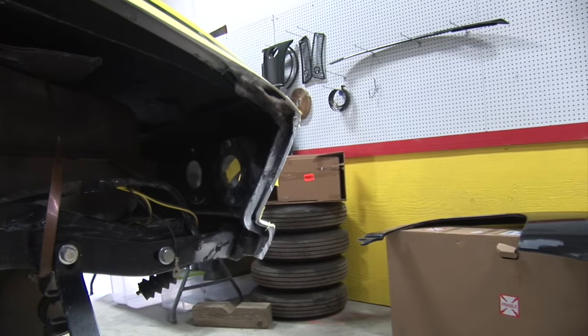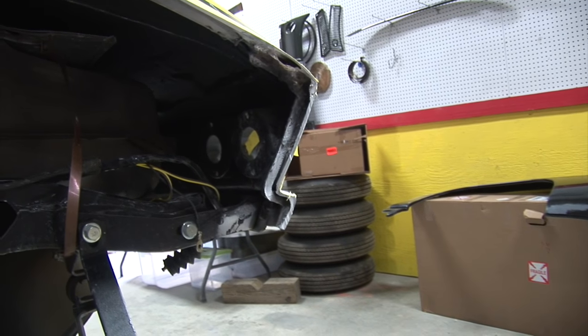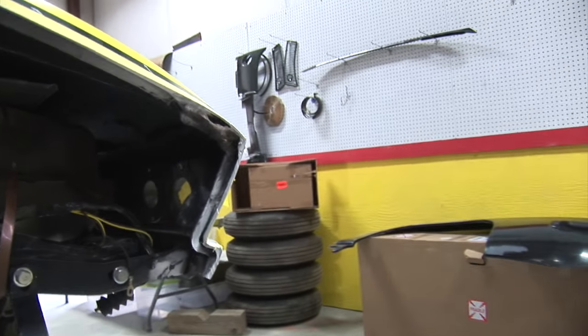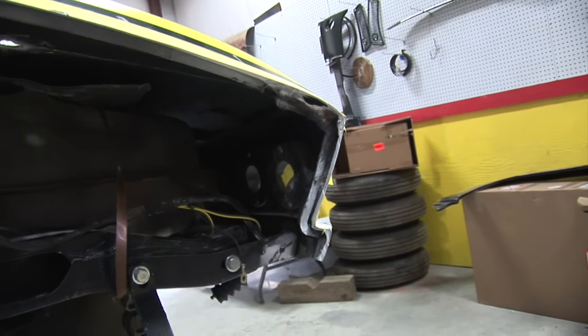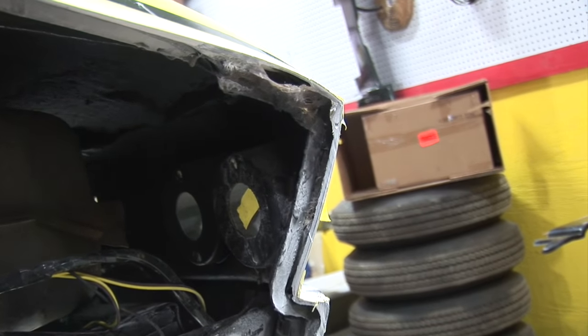All right, here I was getting ready to remove this. Usually I'll take a heat gun and heat this up and take a putty spreader and run between it, and it separates without doing anything. But if you look in closely here in the old panel, it's had fiberglass reinforced all up underneath of it a long time ago and way up underneath. So it's all been reinforced.